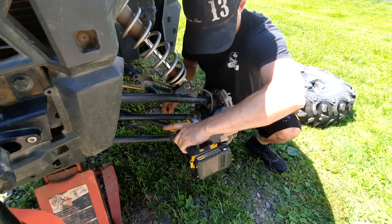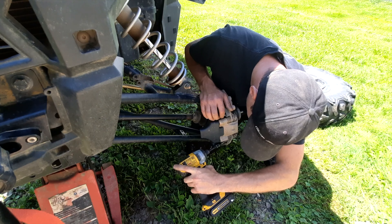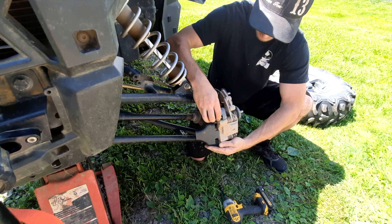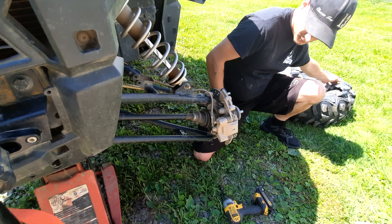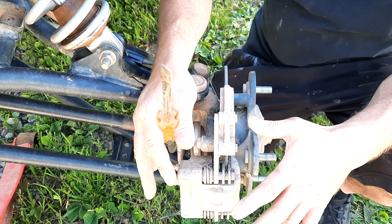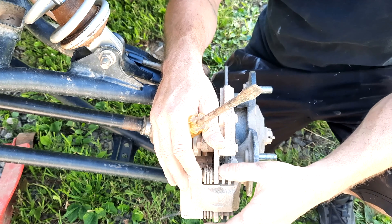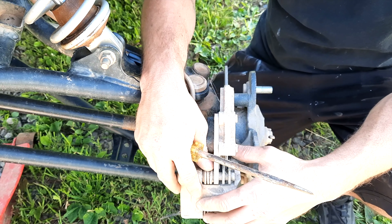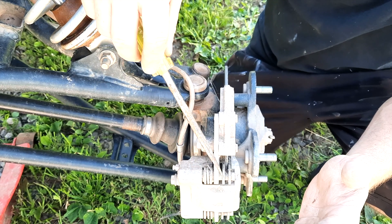When you get in close you can see the pad bracket — you should have a gap between it and the brake rotor. I have no pads left whatsoever. On the other side where we already changed the pads, you can see there's tons of gap and you can see the pad in there. If your pads look like that they're probably still good — just take a second to adjust them, which we'll show you after we get the other pads changed out.